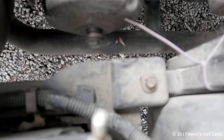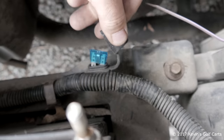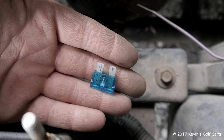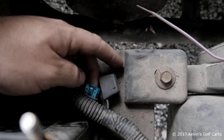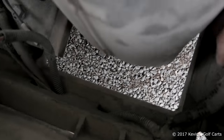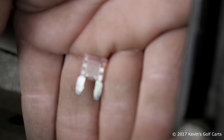The next thing I like to do on these is check the system fuses. There's one here which is typically a 10 amp, but this one is a 15 amp — should be a 10. It's not charred, it's not broken. You can test them with the meter, so that one looks good. There's also a smaller micro fuse — usually 7 amp, 3 amp, or 4 amp — and that fuse is good as well.